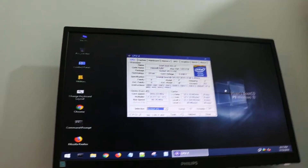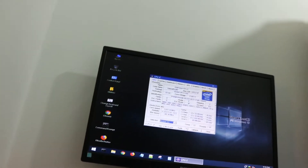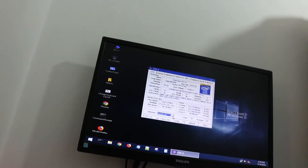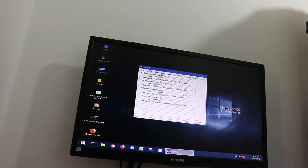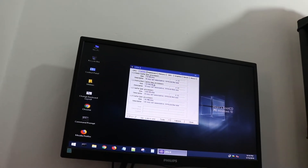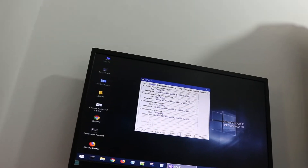The voltage is currently just playing around — 0.6, 0.8, 0.9 — fluctuating up and going. This is the Xeon E5 2673 V3; I have two of those — this is socket one and this is socket two. The maximum speed on this processor is 2.40 GHz. You have the caches: 32, 32, 256. And the L3 is 30 megabytes — pretty good.